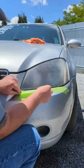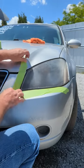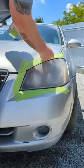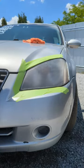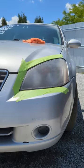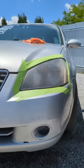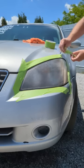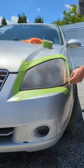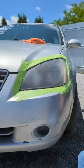I'm going to buff and polish it out, but you still need to tape around all the edges of the paint on the outside of your headlight. You don't want to spend all your profits — and then some — on paint repair or paint correction because you didn't tape off. Usually there's a gap between the headlight, the hood, the bumper, and the fender, so run your tape in between there and make sure all those painted edges are covered.